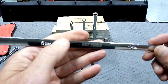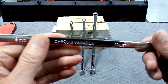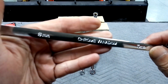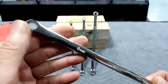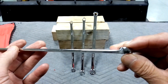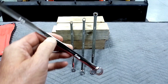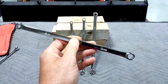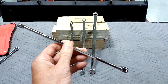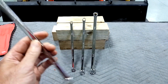Let's go to the bottom here — 10 mil on one side, 8 on the other. Made in China, chrome vanadium, which is at best average. There was some pitting and grinding marks — that's what I expect in this price range. For under $50 for five long wrenches, that's a lot of steel. I don't know how you cannot have a double-box long-reach wrench set in your collection. For the reach and the leverage and the torque — it's just suspension work all day long, hard-to-reach places all day long.